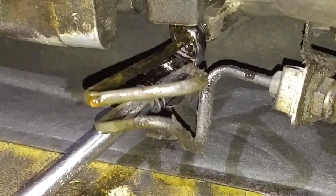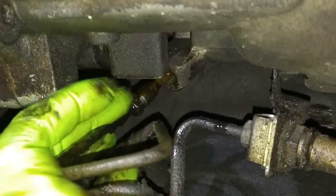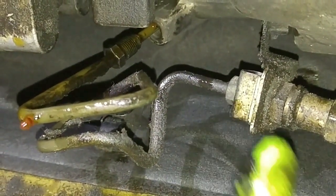Instead of replacing the master cylinder first, I wanted to replace the slave. By detaching the slave cylinder hydraulic line, I could let the hydraulic fluid leak out into a pan. This would avoid a fluid mess when I was ready to replace the master. You'll need either an adjustable angle flare nut wrench, also called a crow foot, or an adapter that fits on a 3/8 inch extension.